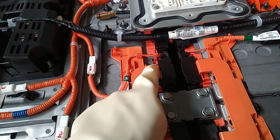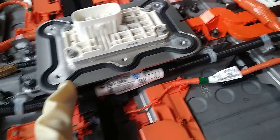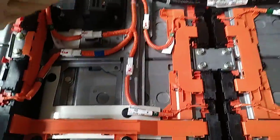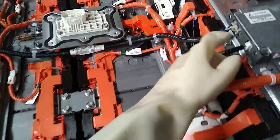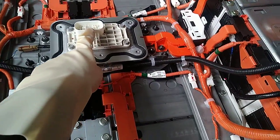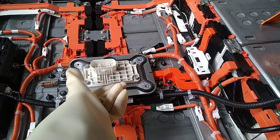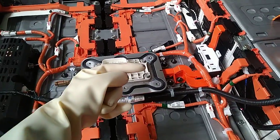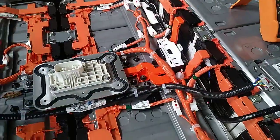I think through here it splits, so it's one-sided. I think it's just this side coming all through here. Then halfway along, this lot goes through the breaker, which is in the reverse orientation to the other batteries — the 24s, 30s, and 40s — because the arrow on that isolator points towards the back, whereas normally the arrow points towards the front of a vehicle. So it goes through there, comes out, and then does the same on the other side.